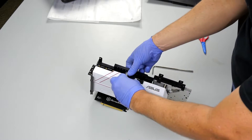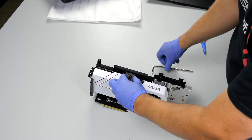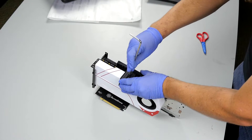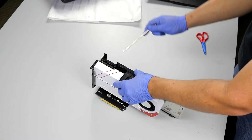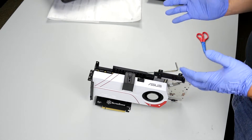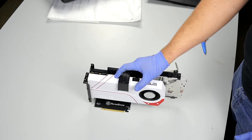There is a hole and we have our screw in this little slot. We line this up, grab our screwdriver, and push them together — not too hard, just gently enough so it makes contact — and screw this down. Make sure that it's nice and tight. Now our video card is very secure. If we move this around, go to LAN parties, or travel with the computer, it's going to keep the card nice and safe.